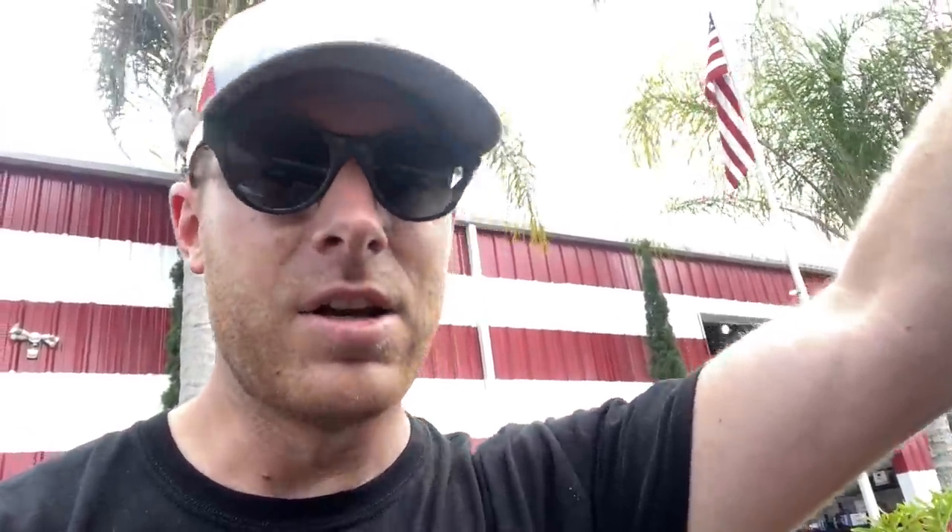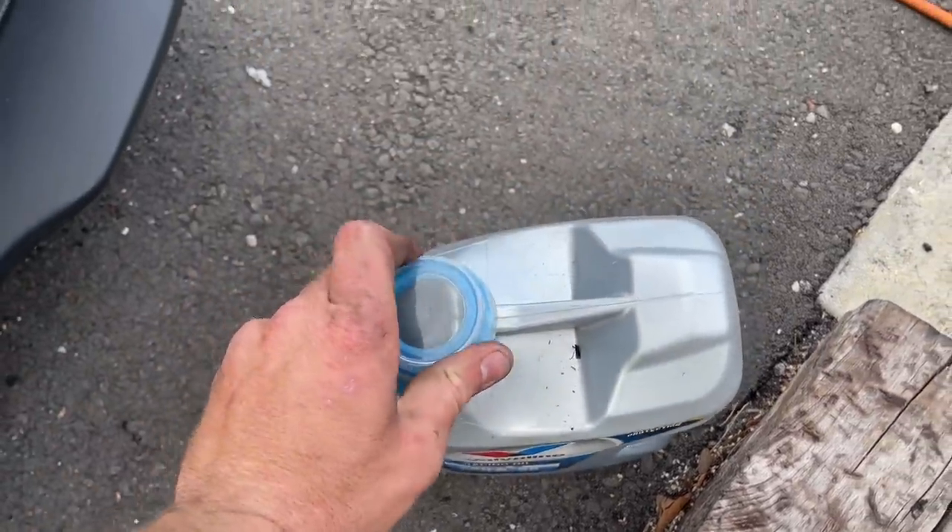If y'all have any ideas, please leave a comment — I read all of them. The boys at Shop Hellcats gave me a tip to figure out what's going on with cylinder one since it's only at 130 psi. To determine whether it's piston rings or a head issue, drop a bottle-cap-sized amount of oil into the cylinder and redo the compression test. That oil will seal up the rings or whatever's going on in the head. If the gain is greater than 30 psi, it's the rings; if less than 30 psi, it's the head.